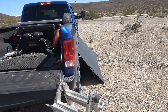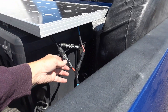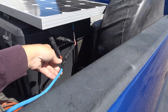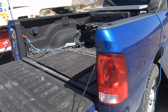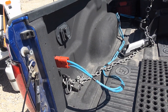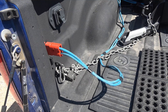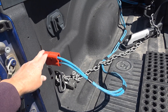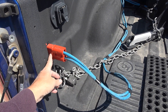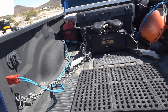So here's the solar panel over here — I can connect a ground panel, but right now just the solar panel is the charging source. For the DC-to-DC charger, this port has been in here a long time. I used the Renogy charger in my RV, now I have the SRNE DC-to-DC charger I'm testing using the same port. Behind here is a four-gauge wire going down to my battery and another four-gauge to the truck frame for positive and negative from the alternator.